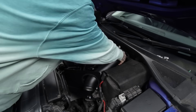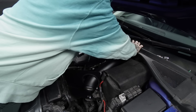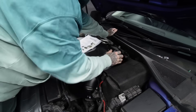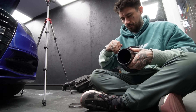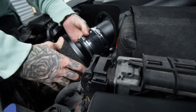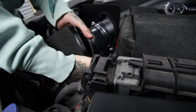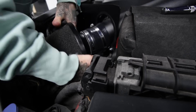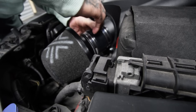I think it might be called an inlet — could be wrong, don't judge me. A bit of fidgeting and moving around and we managed to get it in. I was pretty happy at this point as the bracket lined up nicely on the side of the head. Moving on to the actual cone filter, I had to put a piece of silicon piping between the filter and the intake pipe. I fitted the first jubilee clip to make it solid, then installed it — but I realised I should spin the cone filter so the logo was on top. I'd stupidly tightened it too early, so I had to loosen it back up and re-tighten it.